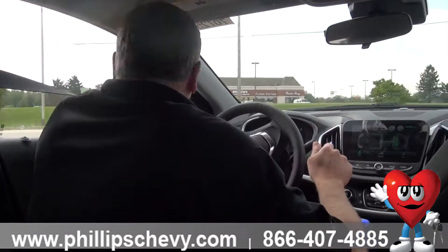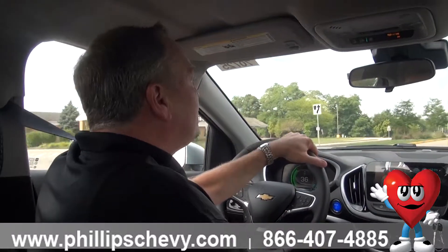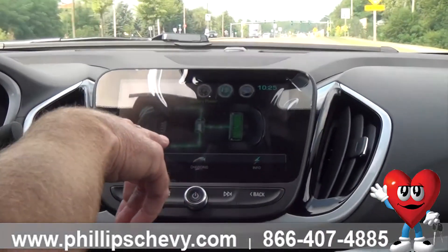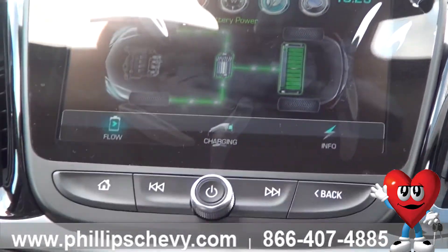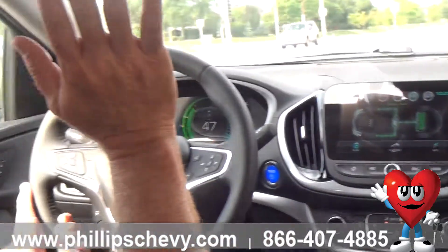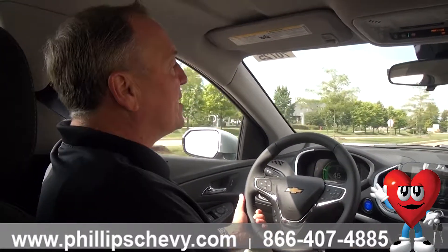What Low mode does is it puts the car back into a regenerative mode. I've got people behind me right now, so I'm going to take a little drive and get up to speed. If you watch as I hit my brake, you'll see it's going to start putting energy back into the battery. We're down to 48 miles of range. I'm going to put the car in Low — when I have my accelerator depressed I'm using energy, flowing it into the wheels. But instead of using the brake, all I need to do is lift off the accelerator in Low mode and the car does its own regenerative braking.